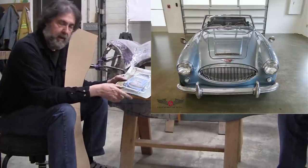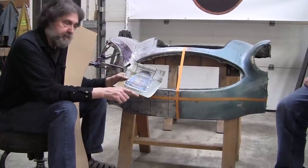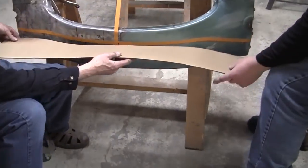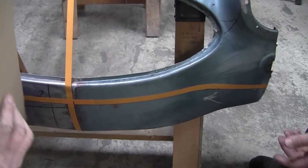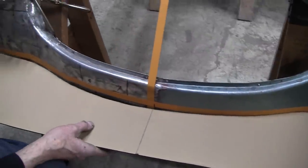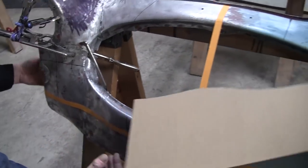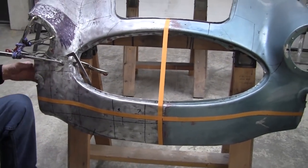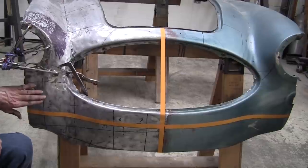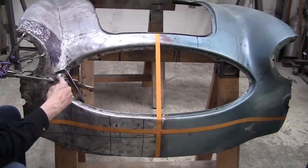So I found a really good picture online, printed it out, and it shows exactly where that bumper pan fits against the front of the car. Eric earlier made this template off of this side, which is not too bad — that fits right there. Actually we got a centerline on here so we can line that up. So there's the fit of this side and you can see this side here has to go in and this will have to come this way. Now we haven't put the reinforcer bracket in — Mark made a reinforcer bracket for here. We got to put that reinforcer bracket in here and we got to move this metal around, and we'll probably use the mobile English wheel to smooth a lot of this out. We might have some shrinking to do over here — this looks kind of bulgy compared to the other side.